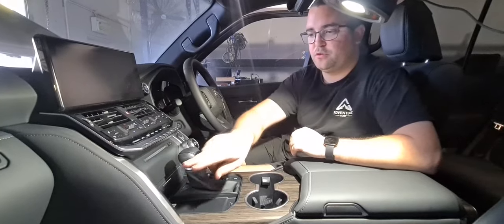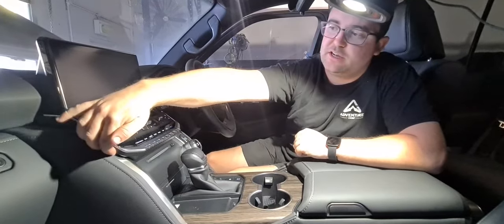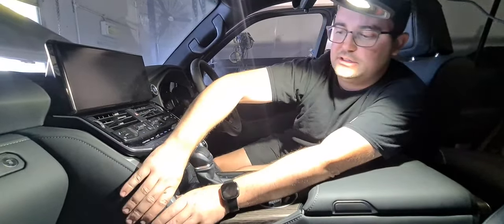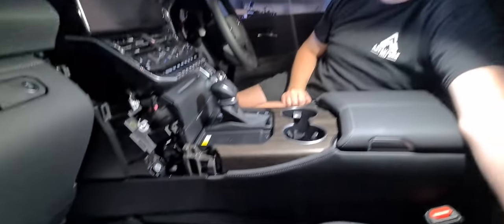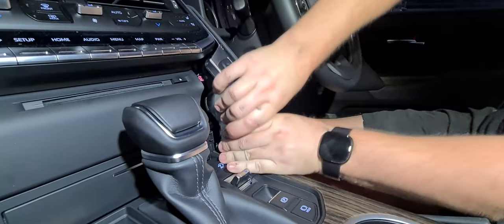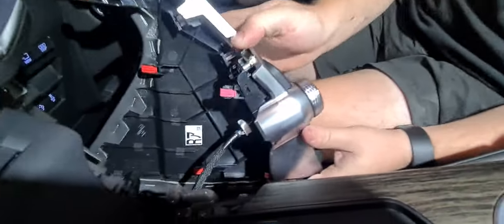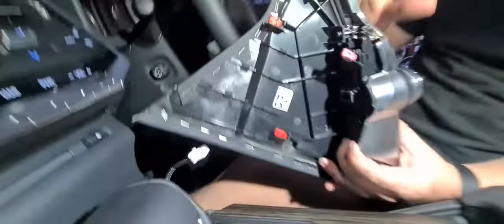To start you have to remove these side pieces because this part goes in underneath it. Now it looks like it kind of goes underneath this little area here, but it doesn't. So you basically just grab a hold of it and you pull it back and out to the side — that's one. They're all just little clips that hold it in. This side's exactly the same. It's got your four wheel drive mode select on it. So you just grab it — some of the clips are quite tight and it does feel like you're having to be quite strong with it. Unplug this one and that's that one out of the way.